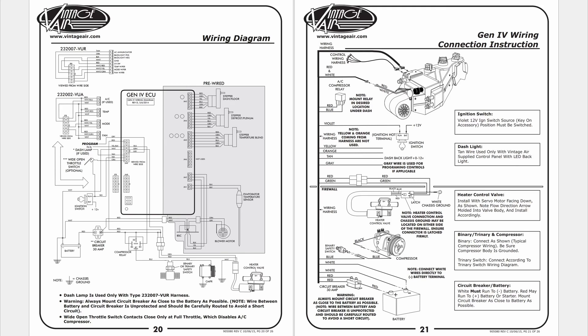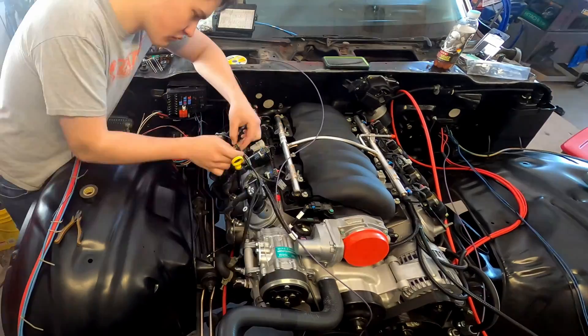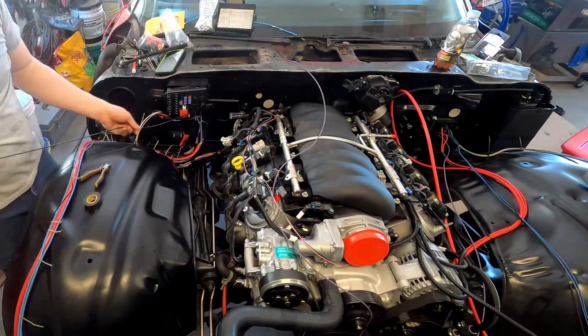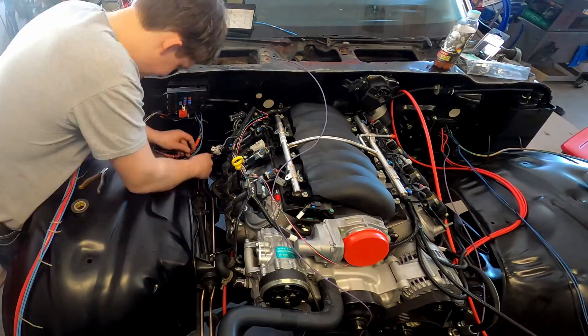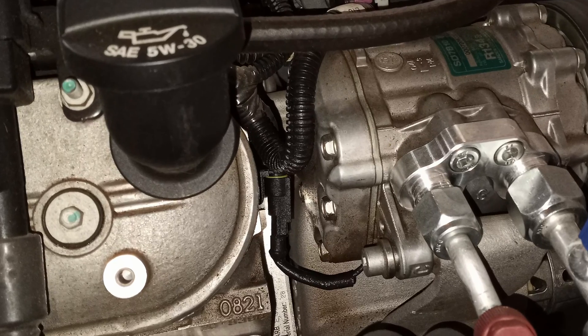The last change is sneaking a compressor control wire into the harness so the engine has a really clean, factory look. In a Vintage Air system, there is a trinary safety switch that will only allow the compressor to turn on if the system is properly charged. The compressor enable wire runs from the trinary safety switch to the compressor. We used black wire for this connection because the wire coming off the compressor is black. In this time lapse, you can see Dylan adding the black wire to the harness from the compressor to the firewall, then adding it to the bundle of wires that runs from the harness fuse box to the front of the car where the trinary safety switch lives. This is what the final connection to the compressor looks like.